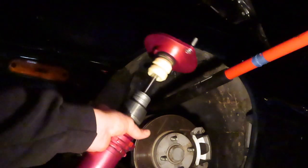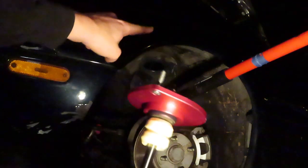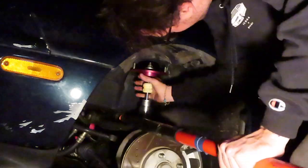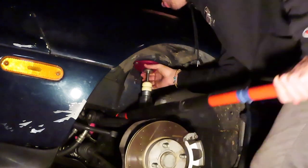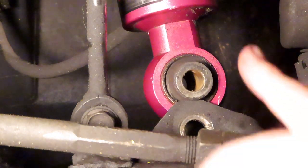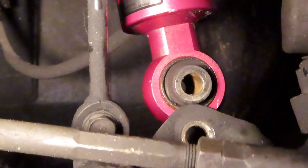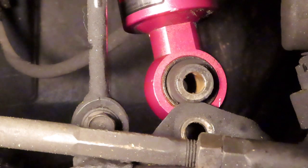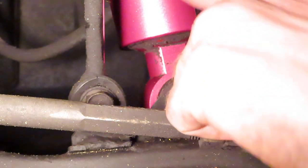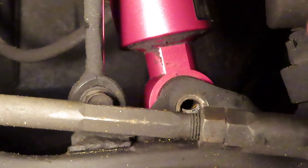Now we're back over here at the car. We've got to set the coil back into the hub area. I'm going to press the whole assembly down using the jack handle, set this in there, and then we'll go up top and tighten the two bolts first. Now we put these two little top hat nuts on — you're going to want to start them by hand, hand tighten them all the way to the bottom, and then from there you're going to impact them on. Now we're back at the bottom of the coilover — this is going to be the hardest part because we have to line up all of these circles to put the bolt through. I actually had to loosen the two top hat bolts up there to be able to turn this whole shock body around.